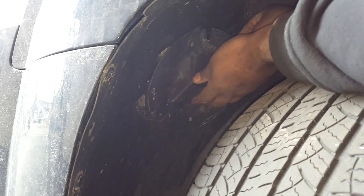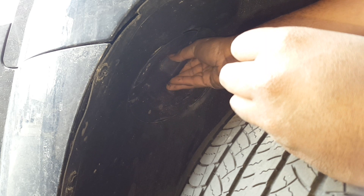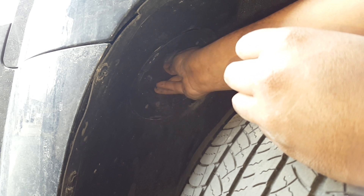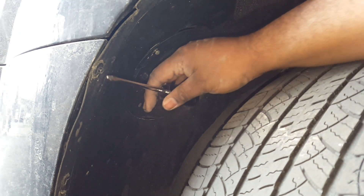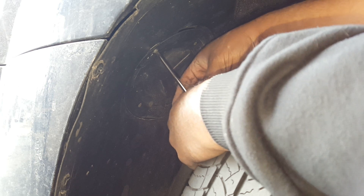Take the second dust cap here — make sure when you're putting it in you're aligning it because you've got to put that screw back. Put it right in and turn, and line up the hole. Then put that screw back in and tighten back up with your Phillips — done deal. That's it, quick and easy. It is a very easy and painless job to do if you have this version.